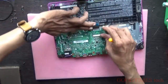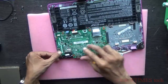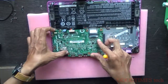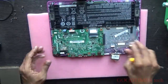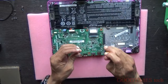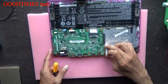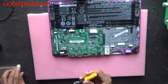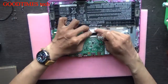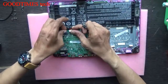Keep all the connectors back. Hold it here, fit the PCB, the current screw locks here. This is your Wi-Fi card — open the screws. Don't forget to connect any of the connectors. Again, unscrew all the screws and insert the touchpad.